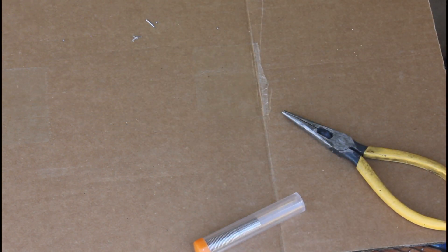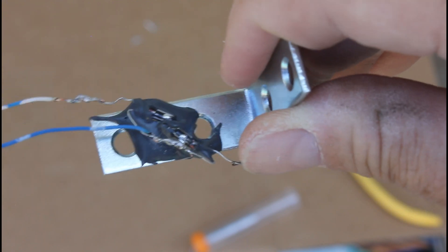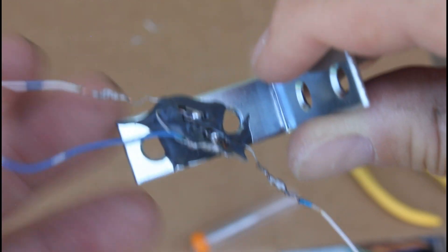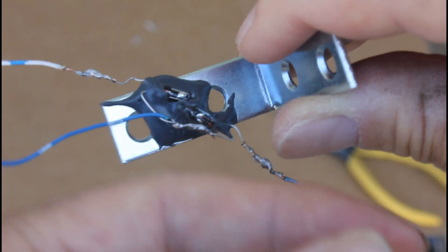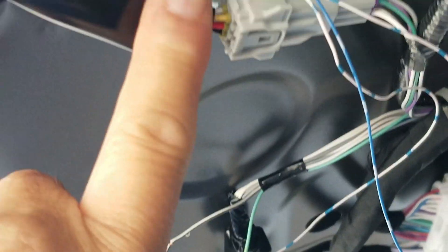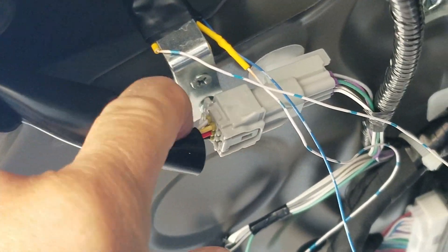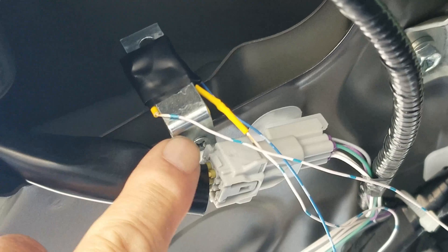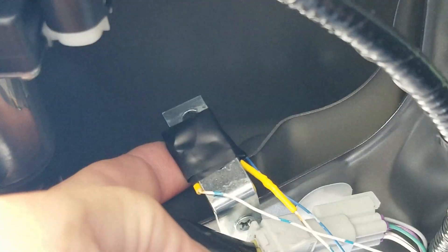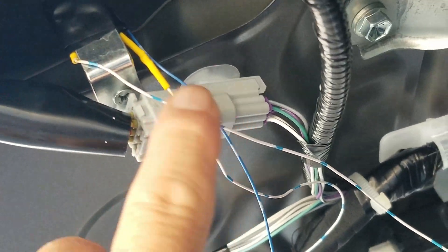Let me bring it up closer. This blue line is attached to both switches, and each switch has a lead coming out of it which will go to the two switches in the hatch. I attached that L bracket right there, right next to this connector, using two sheet metal screws — I just drilled two holes in it and screwed it in. I wrapped tape around the bracket itself to hold it steady, and also put shrink wrap on the two leads that go to the switches.